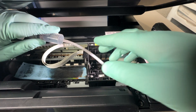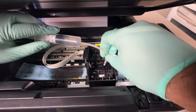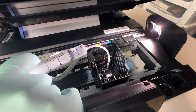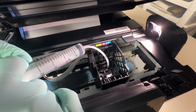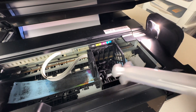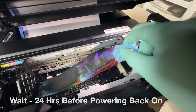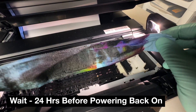As you can see, I repositioned the paper towel because one portion of it already got a lot of ink pushed through onto it — and that's exactly what you want to see. You won't always see the ink; sometimes it will be clear, but most of the time you're going to see dried-up or gunked-up ink being pushed through the system. That is how you are actually clearing the print head — by pushing all of that gunked-up and dried ink out so that new ink can take its place and begin printing normally again.